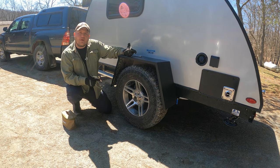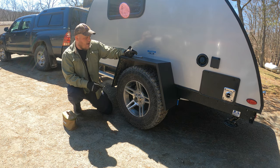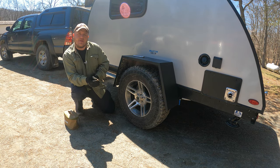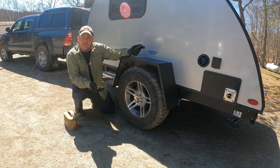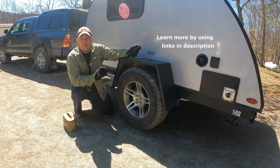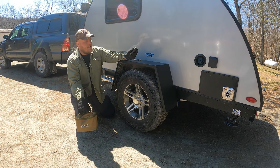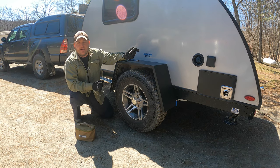For those of us looking for a little more capability, it's important that we do this trial and error. I include these brass tire deflators because each pack comes with four and you can customize them to different pressures. So you might have one for your favorite campsite at the beach and one for dirt roads. It's as simple as twisting these on and it automatically reduces the tire pressure to the number you prefer. It's also critical that we accompany these with a 12-volt pump — you're not going to be able to leave the beach and get back on the highway with 10 or 12 psi in these tires.